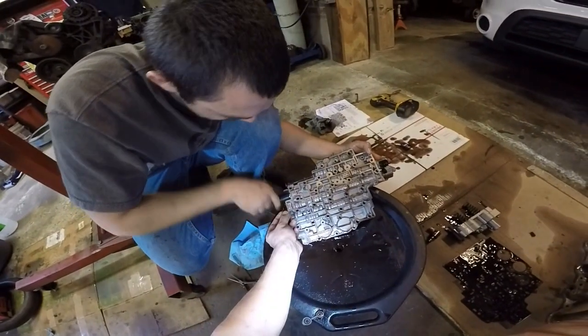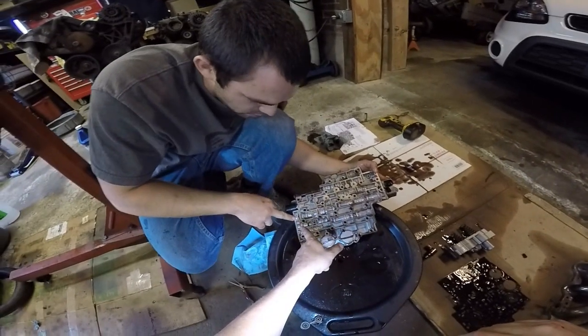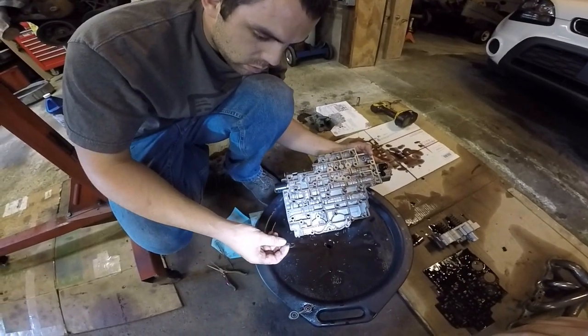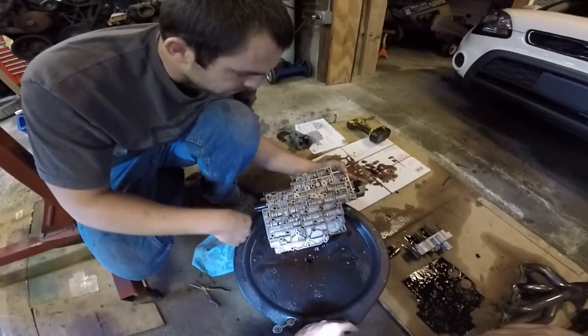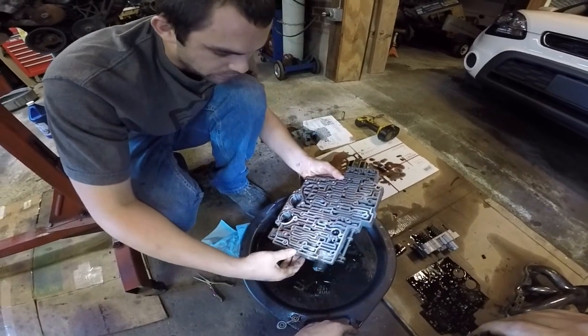Those are the shift solenoids. These are two shift solenoids. This should be a lockup solenoid. Oh, okay. That should control your lockup torque converter. Cool. Yeah, I'll get a pin. I might have one of those laying around. I think I had a spare and I gave it to Mitch for shift solenoids, when we swapped the shift solenoids the one day. I'll see what I got in my barrel in my basement, now that we went that far.